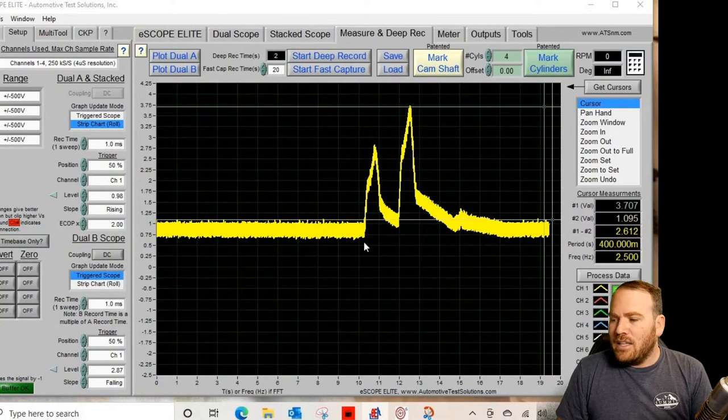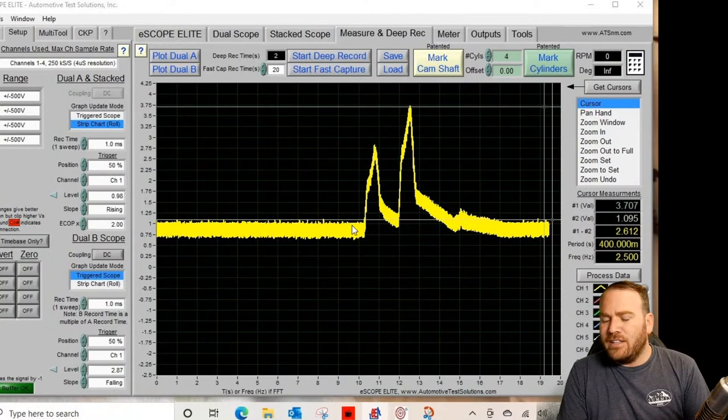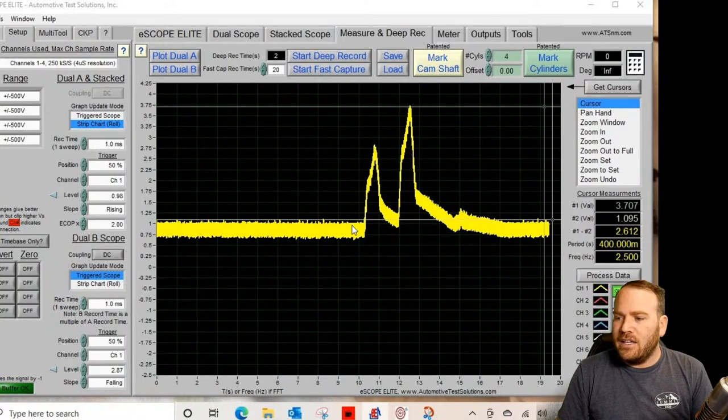We may see something like this where we don't have a big spike at the beginning, it just kind of ramps up, and then you can see where that throttle body closed down and then ramps up again. If you were on a test drive and we did this, we would see a bump at the beginning, which I think there are some posted in here that show that. So here we just have an analog voltage. We're sitting around maybe 0.8 or 0.9 volts until he cracks that throttle open. So this is going to be our idle voltage, and this is going to be the throttle snap.